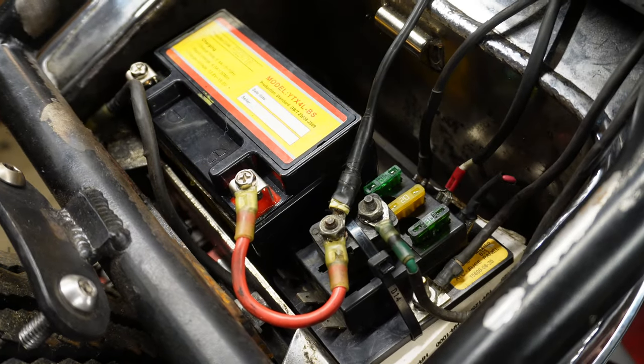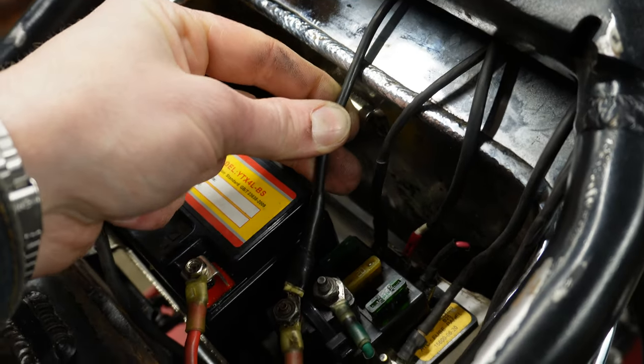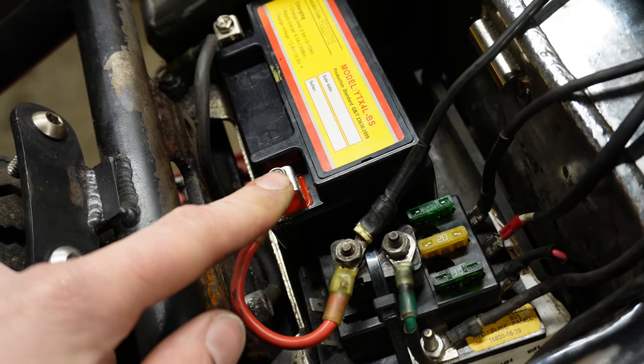And this is our final product. The wire from our regulator rectifier goes right into this terminal which is receiving power from the battery — that is literally all there is to it. If you made it this far in the video, congratulations, your bike is now wired. Give the channel a subscribe, share it with a friend who's having trouble wiring their bike, and if you want to make your ignition as simple as mine, click the linked video to see how to convert your Evo Big Twin over to points.